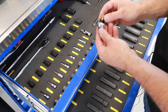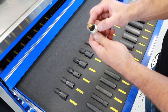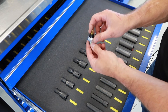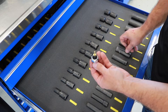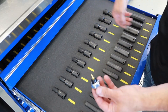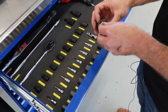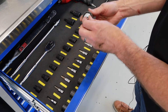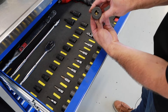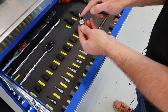When working with an oil pressure switch like this, I want to be really cautious about the type of socket I put on here. Some of these will not have a hex cut but will have a somewhat proprietary shape, and those might require a special socket. This one has just a basic hex, so I can use a regular socket. I keep trying sizes — looks like a 26 millimeter fits the hex shape. The thing to be cautious about is having proper clearance inside the socket so I don't damage the electrical portion or put undue stress on the plastic, which could create a leak just like we're trying to fix.